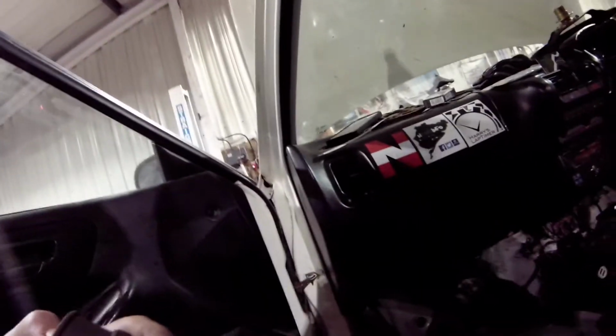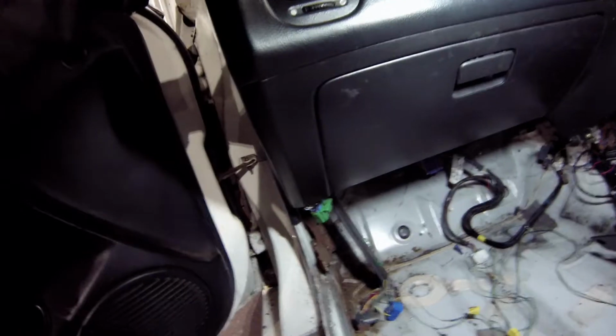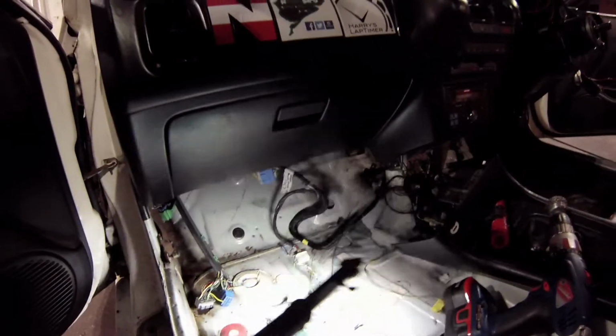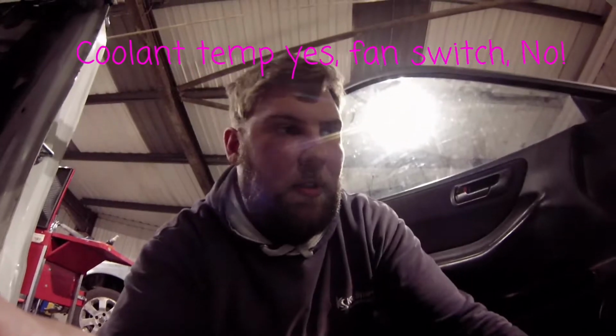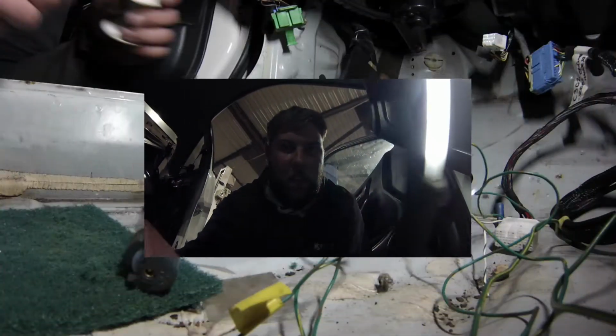some of the wiring. What I've started doing is I've got the fuel pump to wire in, which I've started soldering. You can see that there. I've got the check engine light to wire in. Coolant temp I don't think I need to do because I'm using a Honda ECU. I just need to route some other bits over there, sort out the OBD port, sort out some other plugs and stuff on the other side, but overall there's not a lot left to do, so I'll catch up with you shortly.